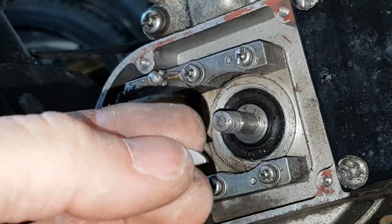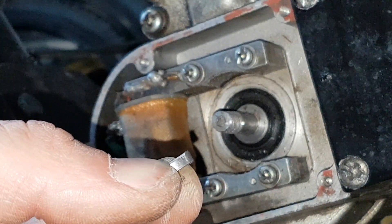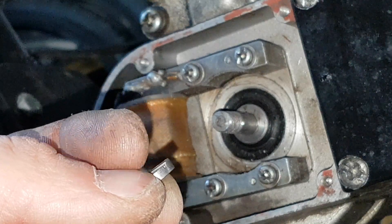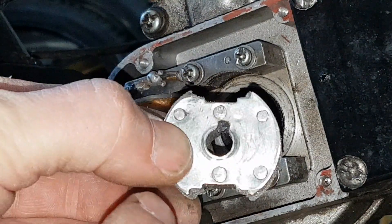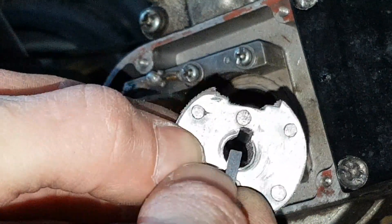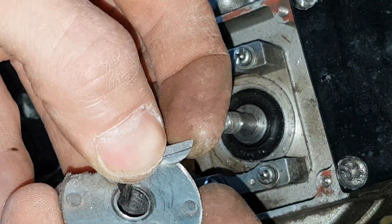I have this keyway here — you can see one side shaved down. It's only half a millimeter, because that's the keyway I had. The original keyway is 2.5mm and this keyway I have is 3mm, so I shaved that half a mil off one side. Then I enlarged the magnet on this upper left side so that it can turn more and advance a little bit more. This thicker keyway fills the magnet hole I cut, and the smaller shaved bottom can still fit into the shaft just fine.